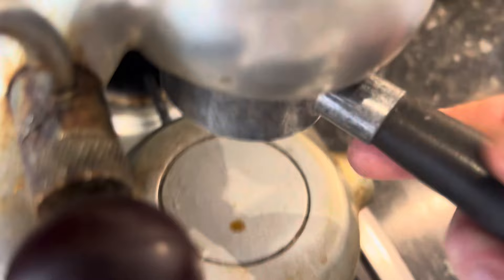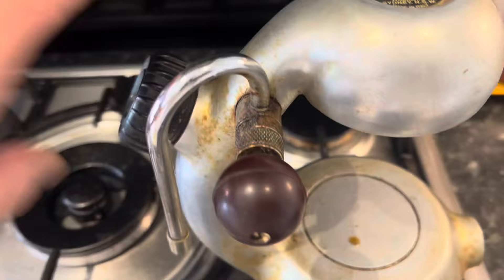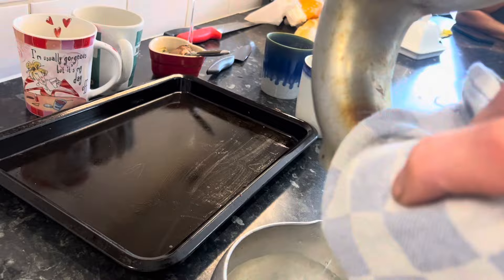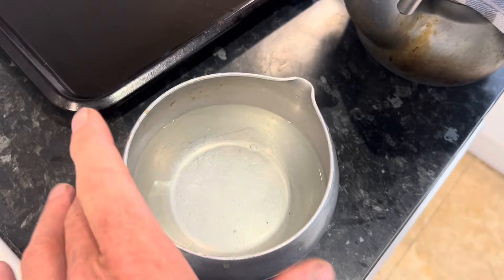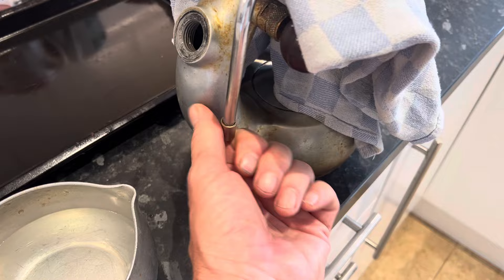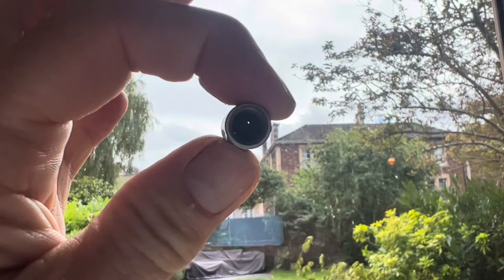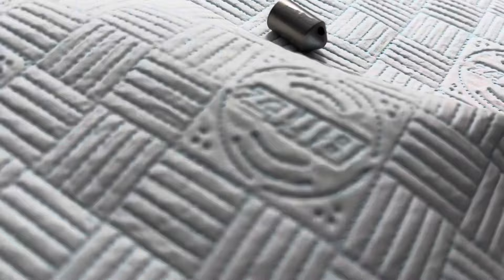Good practice after making a coffee: look at the grind to see how evenly the water came through — that tells you if your top grill is blocked; this one isn't. Also, empty the water from the machine into the jug and shake it thoroughly from side to side. The amount of deposits that come out — practically zero on this machine — tells you how dirty it is internally. No deposits doesn't necessarily mean it's clean; there could be a thick layer. You might need lemon juice to descale. The main visible issue is the end steam nozzle: held up to the light, you can see light only shining through one hole, which is why steam pressure is at half what it should be.